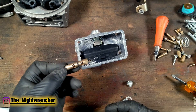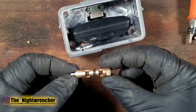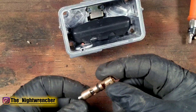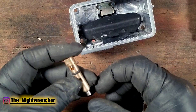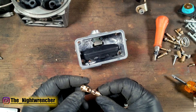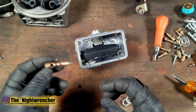My engine was making over 600 horsepower with the 130s, so I wouldn't worry about whether 130s will flow enough. But if you can get 150s at roughly the same price, I'd go with the 150s. Just be a little more careful with the regulator, because as the seat gets bigger, the needles are more susceptible to fuel pressure — you'll have more volume pushing up against the tip of the needle. Make sure you have fuel pressure dialed in so you don't flood your carburetor.